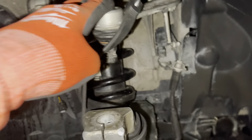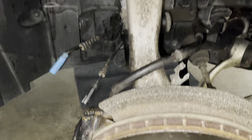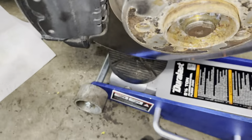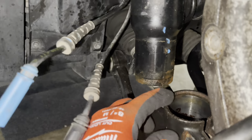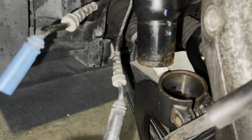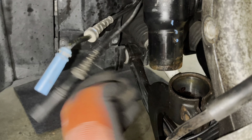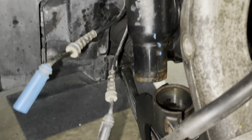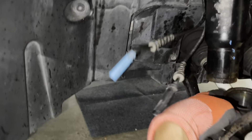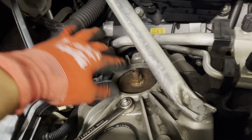I've got it held here because I didn't want the whole knuckle assembly and everything to drop with it, but it's not on the jack. I needed that free space so I could drop the strut from the bracket. The bracket is here - when we're done with this we'll put it back in the seat and jack it back up. The bolt is out, everything's unhooked. The brake sensor is unhooked. Everything now is at the top - we're going to take the strut assembly out and then mess with it in the vise.